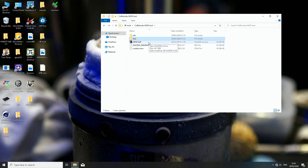So for me, when I wanted to mod, for example, an 8700K or a P0 stepping Coffee Lake 9th generation CPU, like the P0 stepping 9900K or 9700K, a bit older version worked. I think it was either of these two, from March 2019 or November 2018. These two worked all right, but the very latest one had some weird issues at the GOP-VBIOS. So if you have a P0 stepping 9900K, 9700K or 8700K, I recommend you try the older one if the absolutely newest one doesn't work.